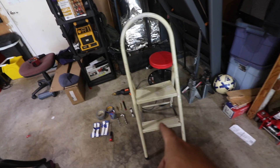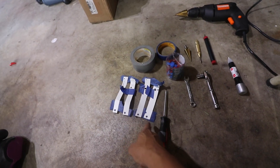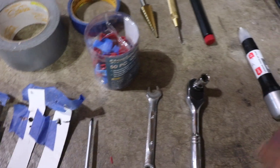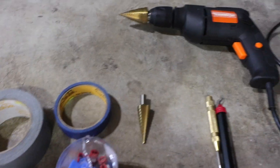This panel needs to come off, but first let's talk tools. You're going to need a ladder or step stool to work on the top of the CRV. You'll need a vacuum because you're going to create a lot of metal shavings from drilling into the door. You'll also need tape — duct tape or masking tape — wire splicing connectors, a number 10 wrench and socket, touch-up paint, and a deburring tool.